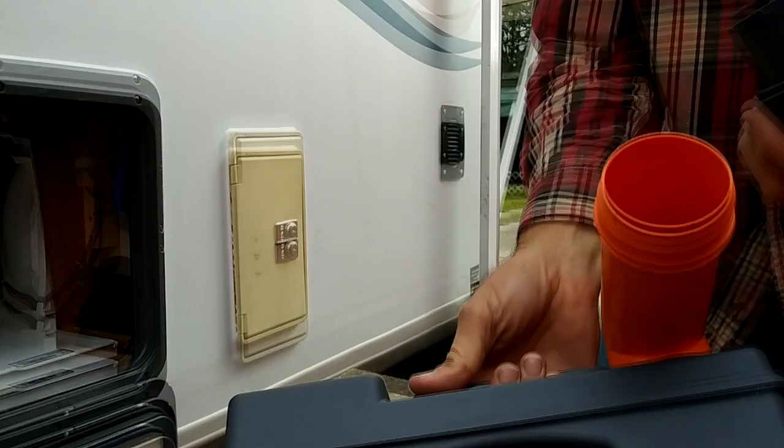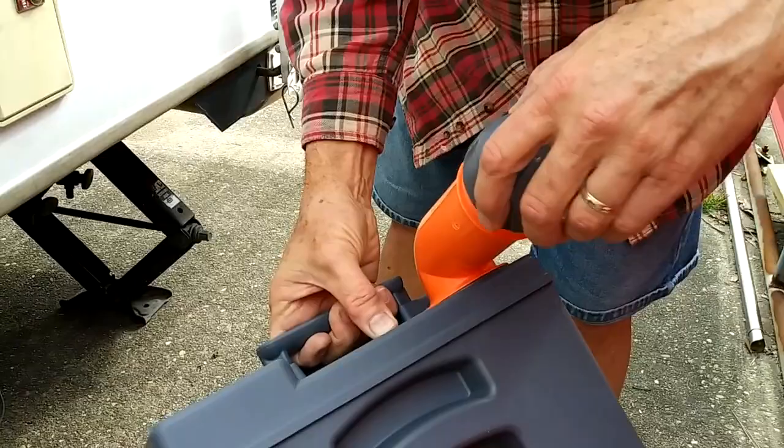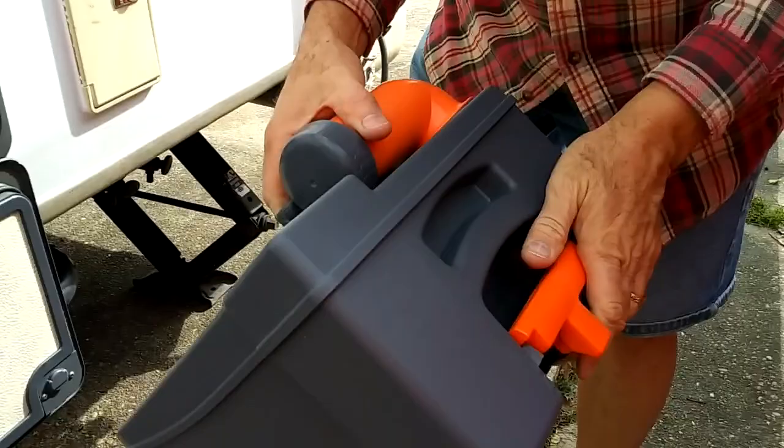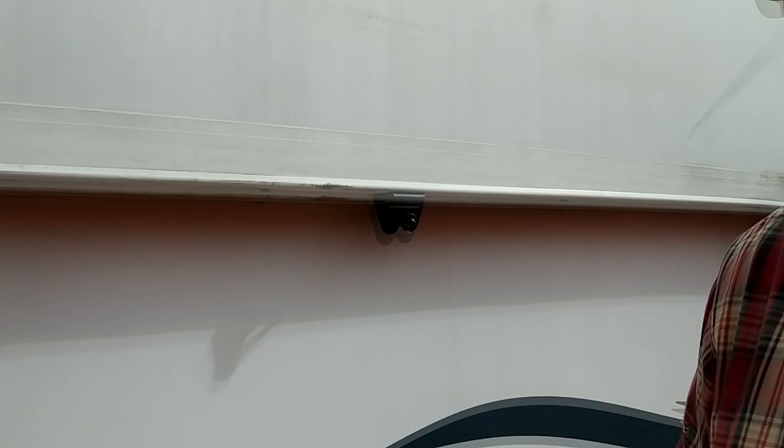Mighty clean installation you got there. Thank you. I had good help. One thing too, on this model, this is the cap that you would remove, and that's where your effluent's going to empty from. But inside the cap, it's got measuring marks. So you pour 2 ounces of your chemical in it, pour it in, and it's a no drip system. Works extremely well. All right, so this lays in here, pushes in, that's locked down. It's ready to use. 4.6 gallons is the total capacity on it. Everything else is pretty standard.